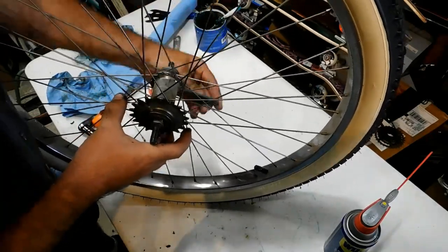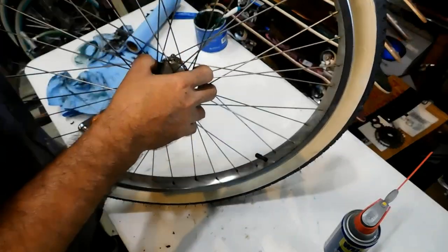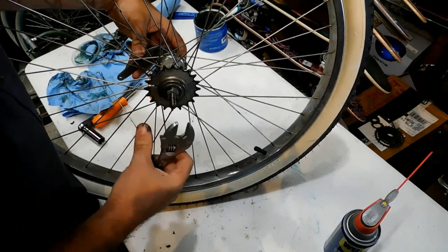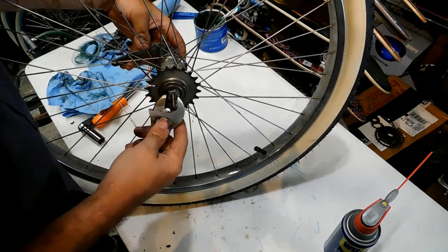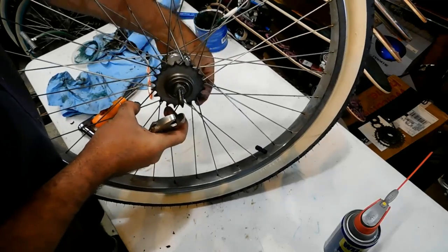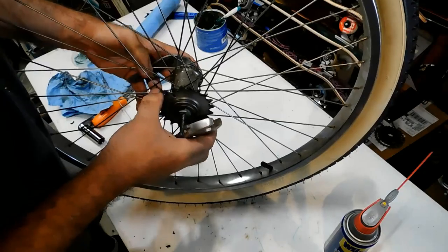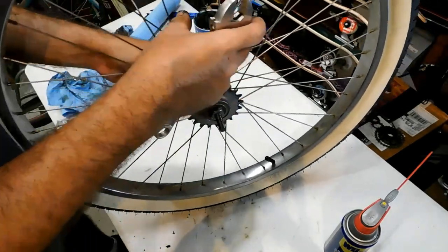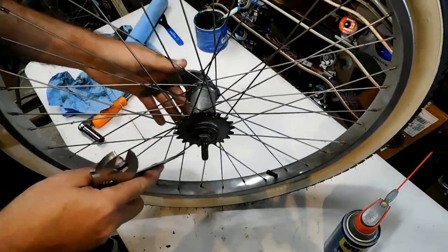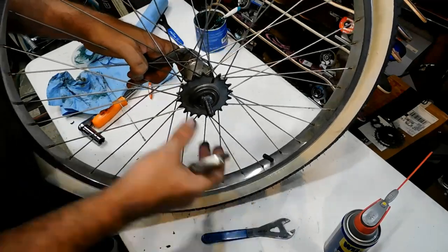We're going to feel the bearings, and we're going to tighten them up. These are not locked together yet, so I want to keep on tightening this up just a little bit until I start feeling some resistance, which I am feeling there. And that's a hair bit too much, but that's okay. We're going to take care of that.